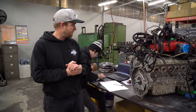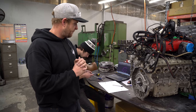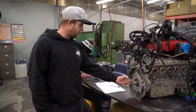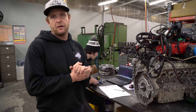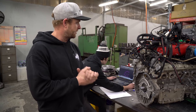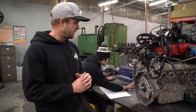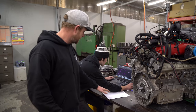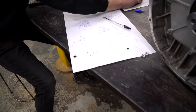The engine's made its way to the machine shop. They're manually getting measurements off the back of the engine - they've made a little locator off the center line of the crank, pretty smart, so they can measure each of the studs. It definitely isn't going to plan - they've worked out it's fully not symmetrical, so it's going to take a bit of time getting the increments and so forth. I did mention it's probably a bit above my pay grade - there's a fair bit going on on that sheet.